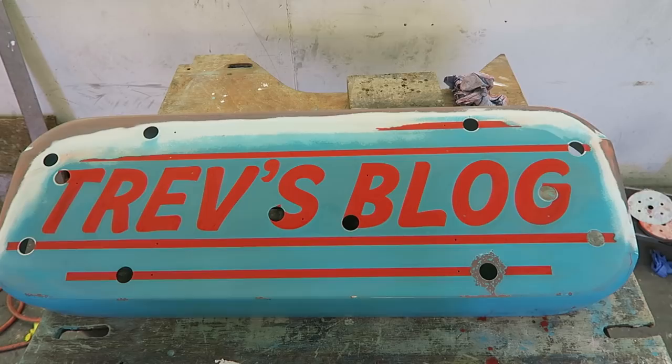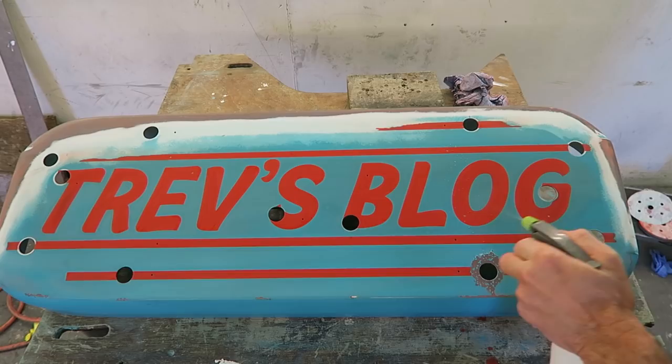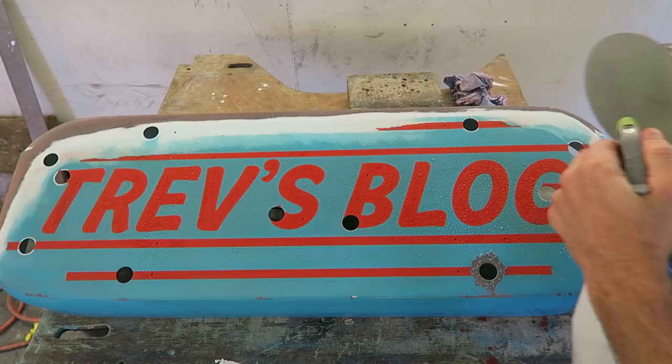And this is going to be the polishing process. So I'm not going to polish this time. I want it to look as flat as possible, but I want it to have that kind of mid sort of sheen, as if it was highly polished once upon a time, but it's literally just been baked in the sun and it's oxidized, so it's still going to look flat but not shiny flat. So let's get the panel well wet. And a disc, just go.